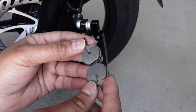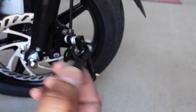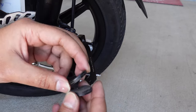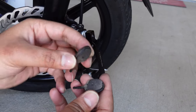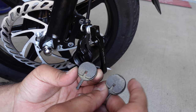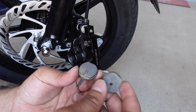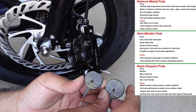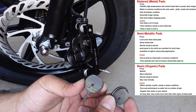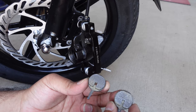This is just a standard BB5 brake pad. Now imagine this is your new brake pad — as I said, my brake pads are still good — and they've got to be facing each other like this. Comment below if you want to know more about the differences between metal pads versus organic pads. The main difference is your organic pads are quieter when you are applying the brake, but your metal pads are stronger. Just let me know in the comment section below if you're interested in that.